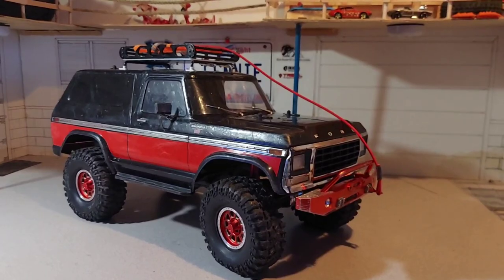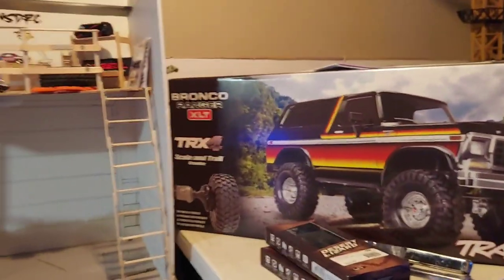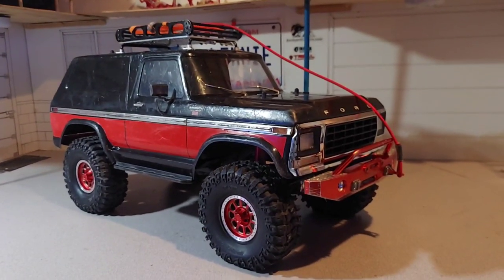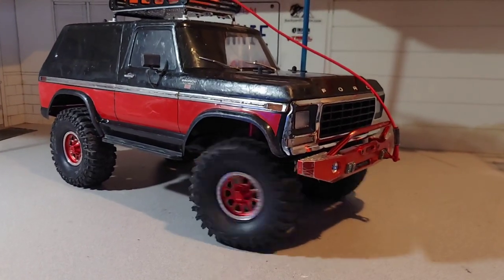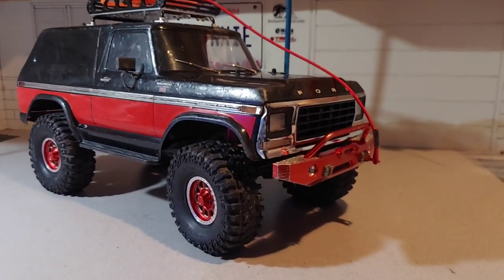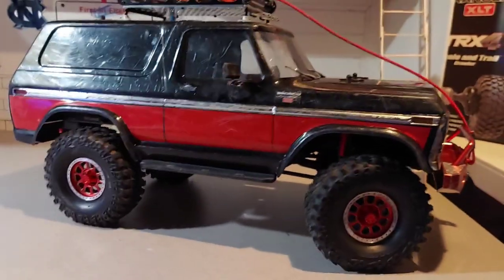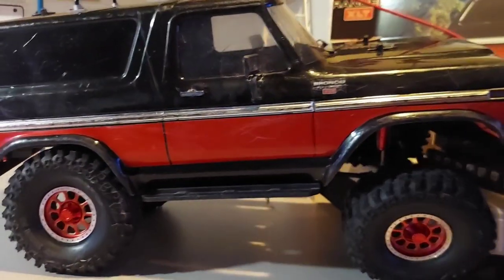We got the truck back together. I put my Trail Master 27-turn — I'm pretty sure that's actually the stock motor in these trucks anyway. I did have to adjust the servo horn; I put that servo in for my buddy a long time ago and it was out of adjustment, so I had to change that. As you can see it does good for a Tactic, so for now it'll be fine. That Trail Master has plenty of torque for slow crawl.